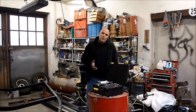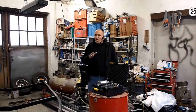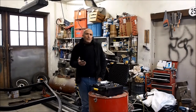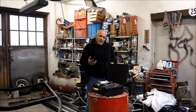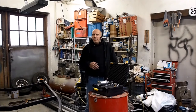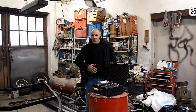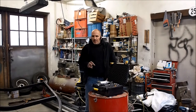And normally what I do is I do three thick layers with about 20 to 30 minutes in between. And then you let that dry at least 24 hours, better a little bit longer. I mean, if you have a paint booth and you can heat it up, it's a different story. But if you're the do-it-yourself guy and you have just a regular shop and no paint booth, at least 24 hours. Then you start sanding it.